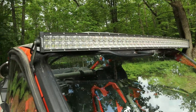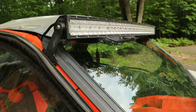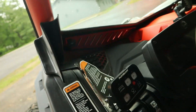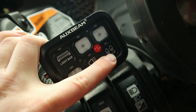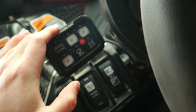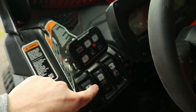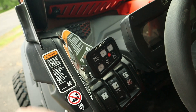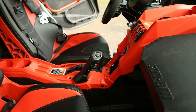I am not sponsored by Aux Beam but their products are pretty good for how cheap they are. The next mod is the Aux Beam switch panel. I have buttons for the light bar, my X-Bright chase bar, a separate one for the white LEDs on the X-Bright, and three still open for future mods. Instead of individual rocker panel switches for each thing, you can have six of them mounted on here. I have the controller temporarily mounted down here - once I do my radio and enclose this cubby area I'm going to move it up in there. It's pretty sweet and makes it easier to install any electronics on the vehicle.